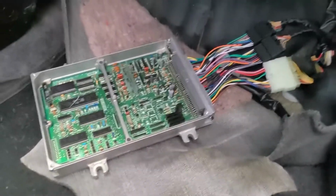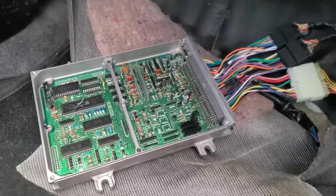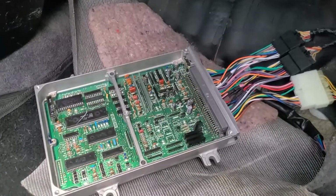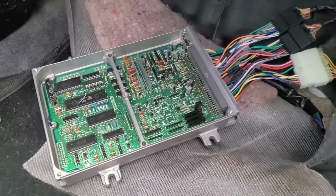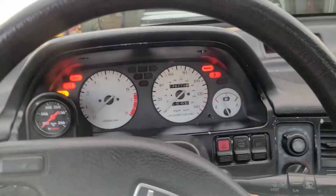Okay, the OBD1 ECU's in. There's the jumper harness, everything connected perfectly. I'm just hoping that this ECU works, the chip's good, and this thing starts. Hopefully I can verify that before I take the ECU out of the Accord, and then figure it out and fine tune it with Moates Ostrich. All right, I'm going to try first startup.